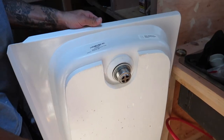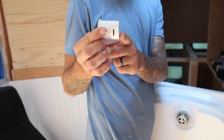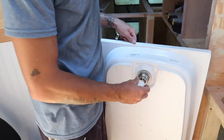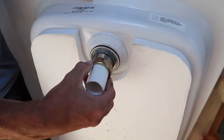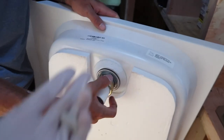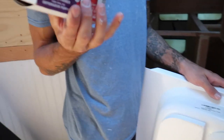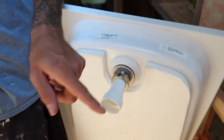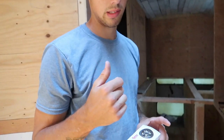Back to the underside. We've got this little section that I've already cut that basically sits flush with the underside of the bus. Then we've got the plastic washer — that sits inside this one. This will then sit on there with the nut when it slots on. So this will stick through the floor, then from the underside of the bus I'll attach this adapter with plumber's cement. And then this will go into an inch and a half P-trap under the bus, and then to the grey water tank.